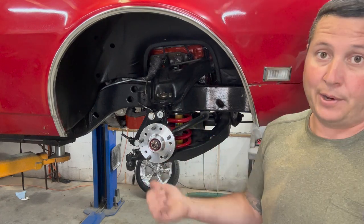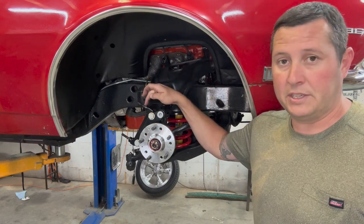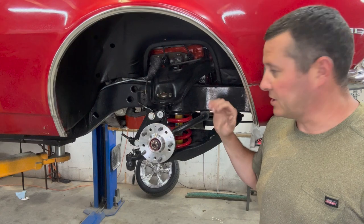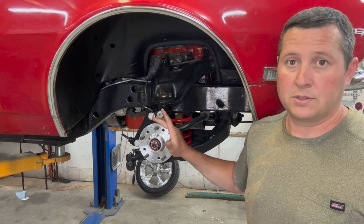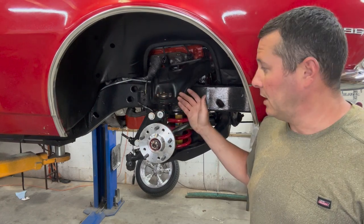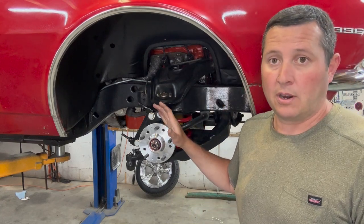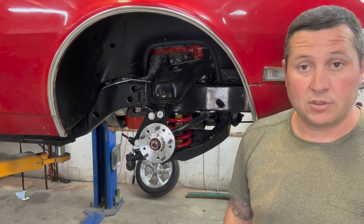There is no cotter pin, but I've obviously got those laying around. Blue Loctite everything. I did go ahead and pack the wheel bearings and all that stuff with wheel bearing grease — I like the Lucas, the sticky red. Awesome grease. So this is coming together really easy. All the parts are just super high-end finished. Really impressed with it so far. Everything fits perfect. I followed their spacers to the diagram for the disc spindle and everything lines up perfect — the rotor centered in between the caliper pads. Good job. I'm going to go ahead and do a final assembly on this, Loctite all the hardware, get this side buttoned up, do the same to the other side, and start tearing the rear end down. So far it's just a win-win.